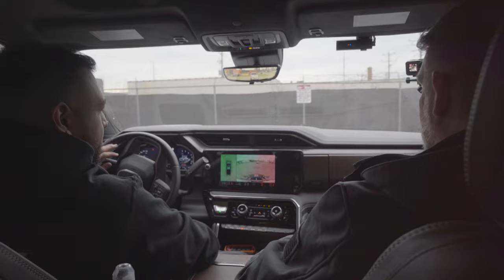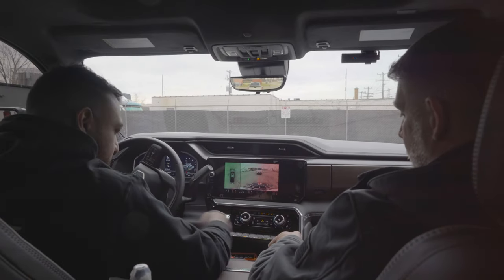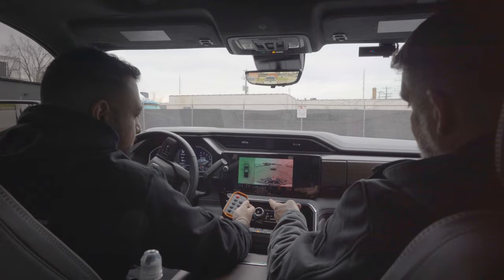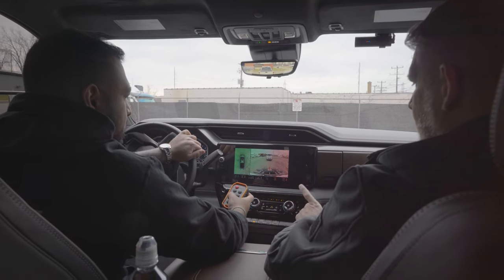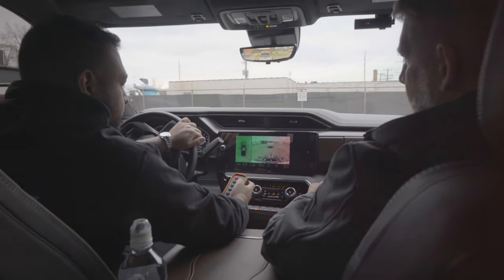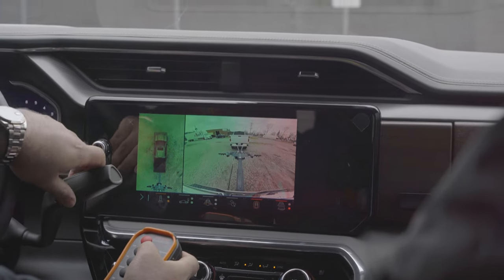First thing I like to do is make sure that your switch is on for the PTO, because nothing will work unless that's on. Then turn your controller on. Hold the red button for 2 or 3 seconds, and now you know it's on because it's blinking. At this point, my first thing was I would just tap the jaws closed one time. Just tap it right there. That's perfect. Now I go out all the way and listen to the distinct sound of the pump. Look how fast that is. Keep going until you hear it. Too close to it, I don't want to hit the car.